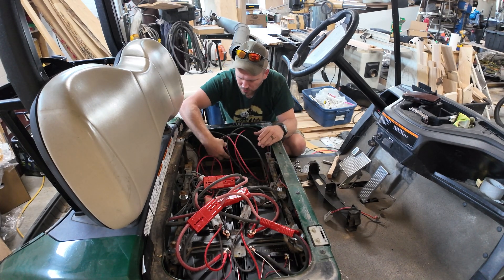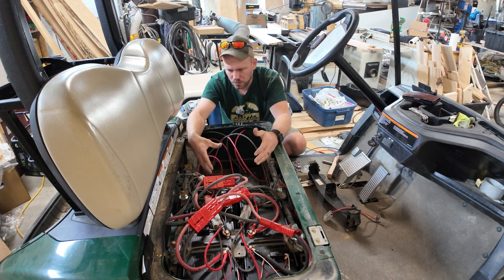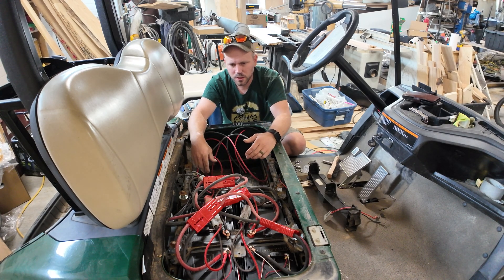We're going to mount the charge controller inside and put the back cover back on the golf cart. If you mount the charge controller on the side here you have plenty of room — you could put a box in here for tool storage or a small cooler, it just opens up more space. One thing I forgot to mention: anytime you put batteries in series it's always a good idea to charge each one individually to 100% before hooking them all together. Most manufacturers recommend this — it's the only way to ensure they'll all reach maximum charge and stay at the same state of charge. I let these sit overnight charging each battery individually and now we're ready to do the test run.